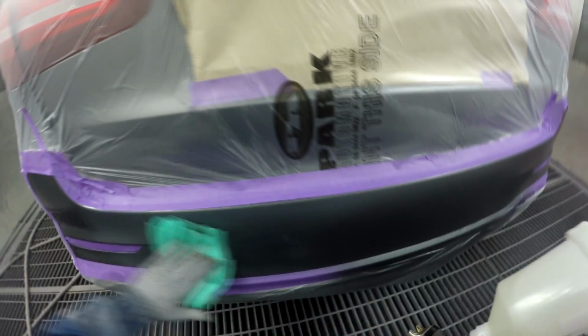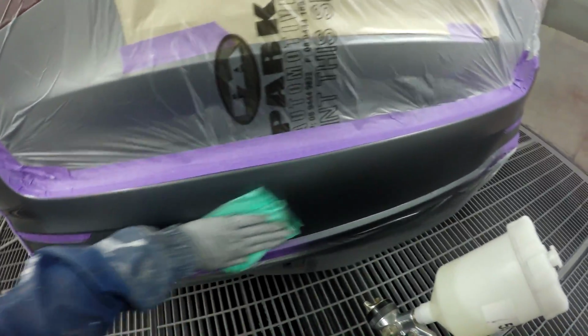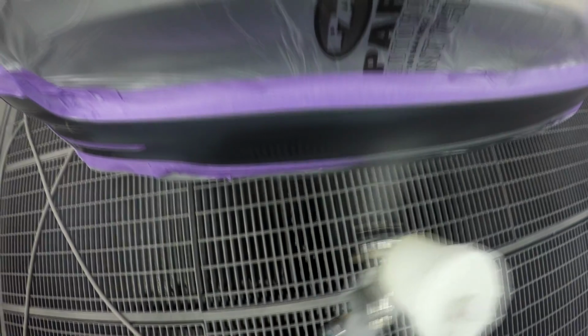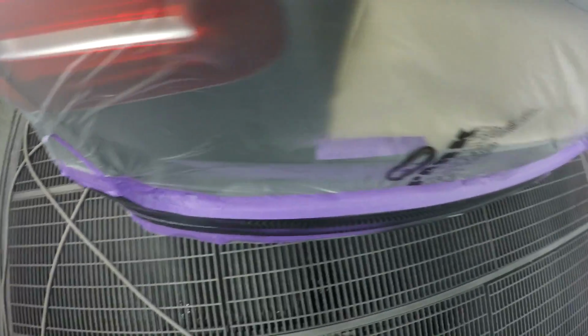Yeah, pretty solid gun this thing. ANI F160 silver. So what have I got there? The 1.2. I just leave 599 in that all day, every day. It's not spraying properly, it's getting it on, but oh no, it is. I felt like it was spraying around the corner. It's all good. Getting on track. The air cap might need a bit of a clean or fluid tip or something.